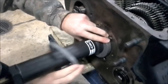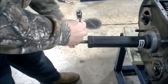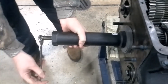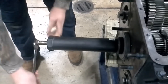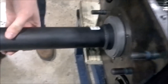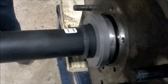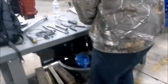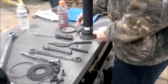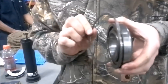Now I've got my bearing halves on there — the puller is ready. Now I take my 13/16 wrench. I hold my input shaft puller at the same time as I turn the screw, and slowly as I turn the screw you'll see it pull the bearing out of the transmission housing. Slowly but steadily — now my bearing is out. There's my bearing. This is the front face of the bearing and this is the seam that the snap ring was sitting in.